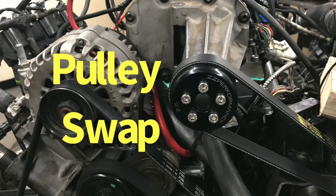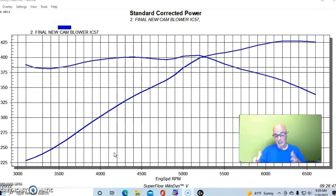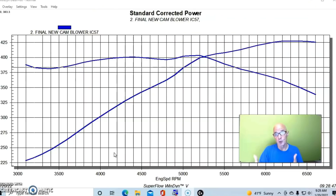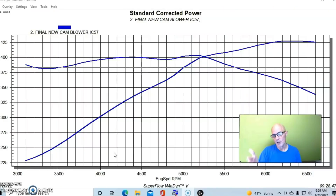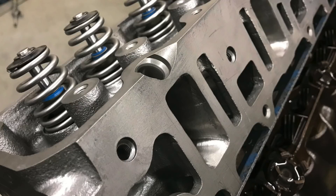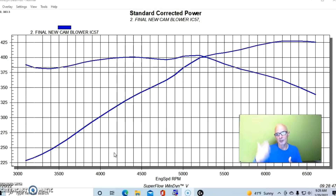To illustrate the difference between the turbo and the M90 supercharger on our 3800 V6, we need to look at the highest power output achieved with the M90 — that was run with a 2.6 inch pulley. Our combination had a stock L67 short block, ported heads which really didn't improve the power, and our ZZP NIC cam which is a 507/220/230 and 112 degree lobe separation angle.